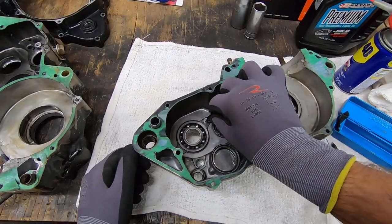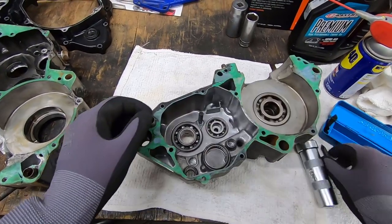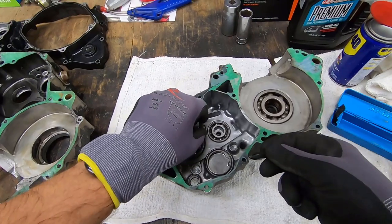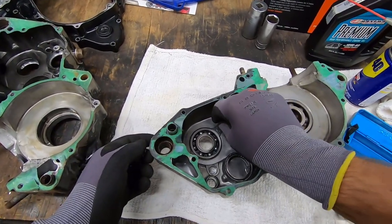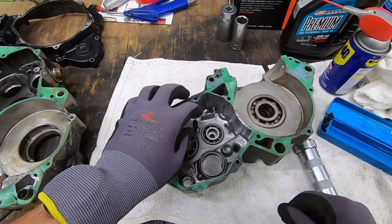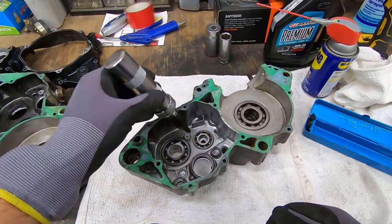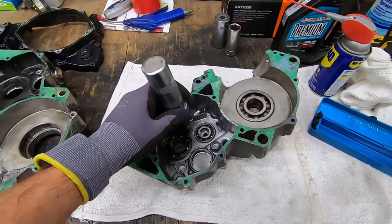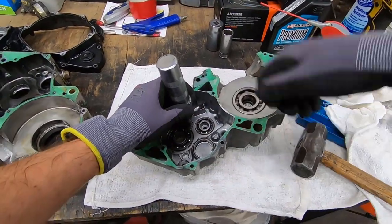These are the big boys right here, so you're gonna go ahead and make sure that that fits. You can see clearly if you were to put the number 2 in here that it does not fit properly. It's a little loose, and do not use that. So number 3 Phillips. All of the time I've been in this situation, it's the number 3 Phillips inside. Once you've set this tool in the right direction, there's only one thing left to do, and that is take the impact screwdriver, hammer with a little weight behind it, and go ahead and give this a whack.